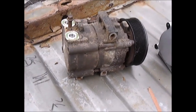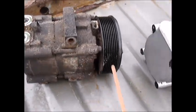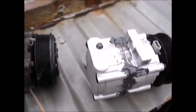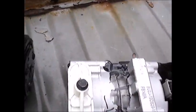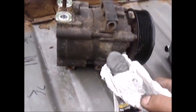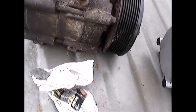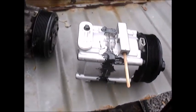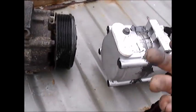So I got new factory bolts and I coat them up good with a high-grade anti-seize. For these cavities, I use this electrical putty — you can get it at Lowe's or any hardware store, relatively cheap, and it doesn't harden. After everything is bolted on, I jam the putty in the holes. My philosophy is that mother nature does not like an empty space — if you don't fill it with friendly material, nature will fill it with unfriendly material and cause you grief later on.